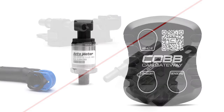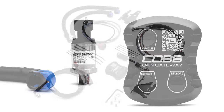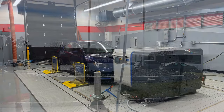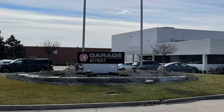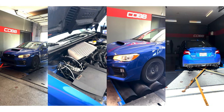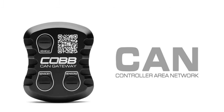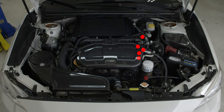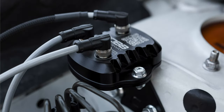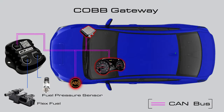One of the best parts of our Subaru next-gen stage 2 plus CAN gateway flex fuel power package is that it has achieved SEMA emissions certified status by our industry partners SEMA Garage, so you can have confidence that our package and calibration are safe for the vehicle and the environment. CAN stands for Controller Area Network. These cars have a physical network built right in that connects all the systems in the car together so they can easily share data. The Cobb CAN gateway allows our flex fuel kit to communicate directly through the network independently without impacting any existing sensor inputs on the car.